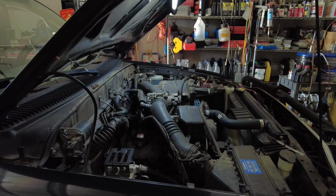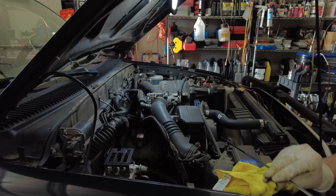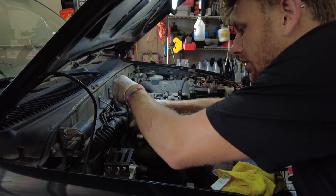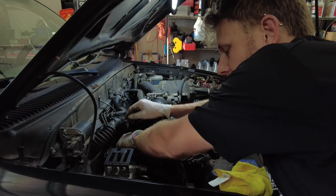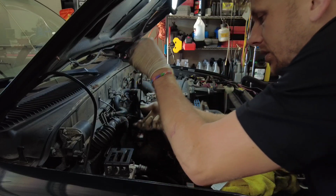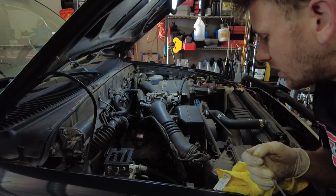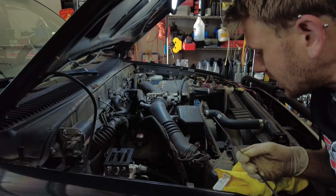Grab my cloth there that flew off, and by check a few times, I mean just to make sure your eyes on the stick are correct. You know, clean it, insert it, remove it those 2 or 3 times. Make sure to push it all the way down, seated. This one has a little tab that covers the top of the dipstick, and it is right at the top.